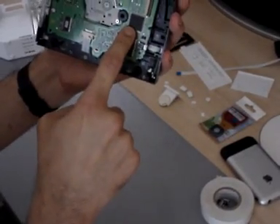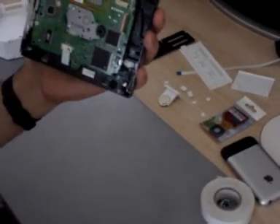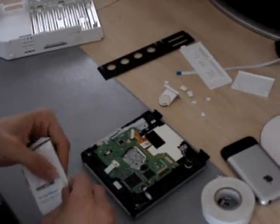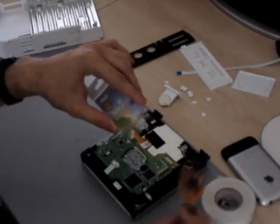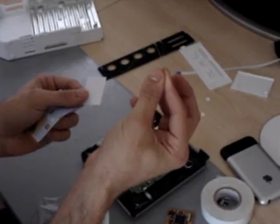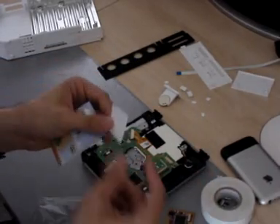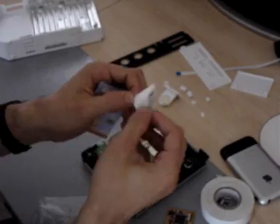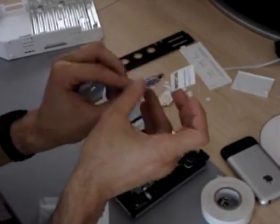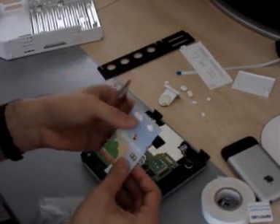This part here is the security chip, and hopefully you've purchased the right modchip for your security chip — this one is D2E. The Wii clip package comes with an extra wire which is for certain versions of the D2 Pro that have difficulties and require soldering one wire, but it should be 100% solderless now with the latest firmware. It also comes with a little protect label — most people like to put it over the chip, but we'll leave it out for today's purpose.